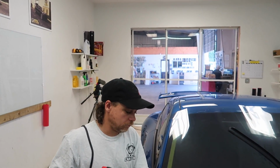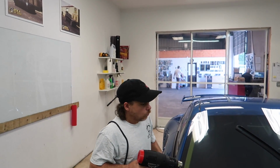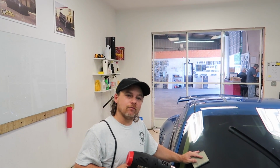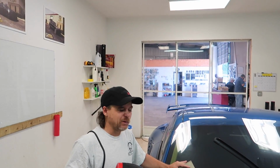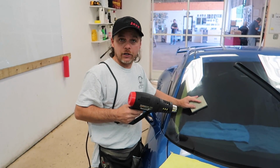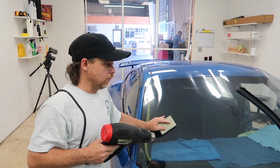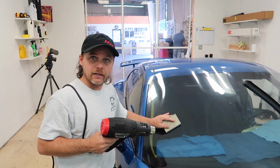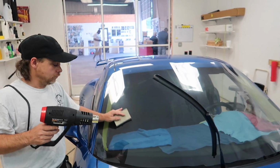So what could you do wrong? You scratch it up? Well, with the Crystalline, if you go too fast with it, you can blur the layers, and so it won't shrink evenly, and then you'll have kind of a funky, blurry, really nasty look through it. So when you're a driver looking through the film, the most important part is the clarity. When your eyes fixate on an area that is distorted, it can cause a little bit of a problem. Makes sense.